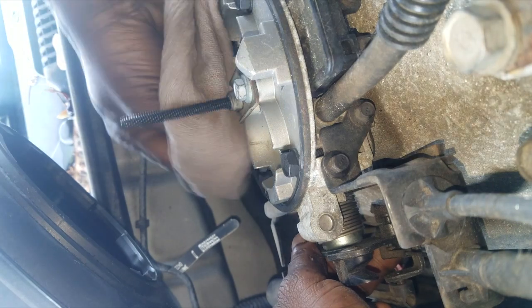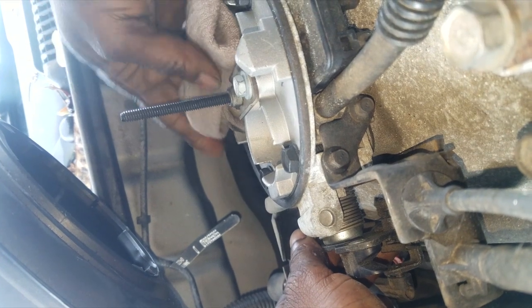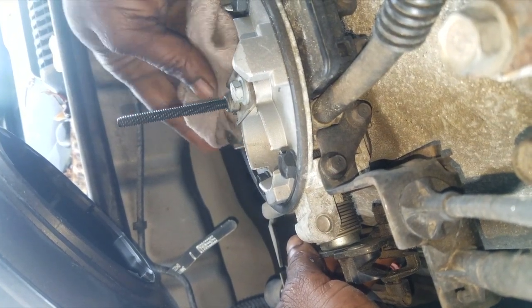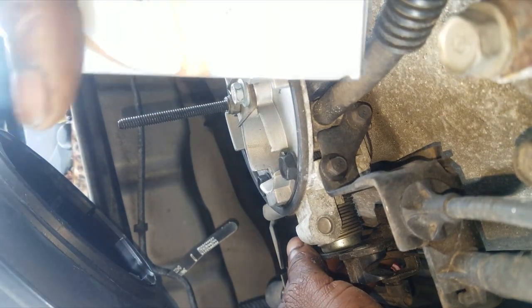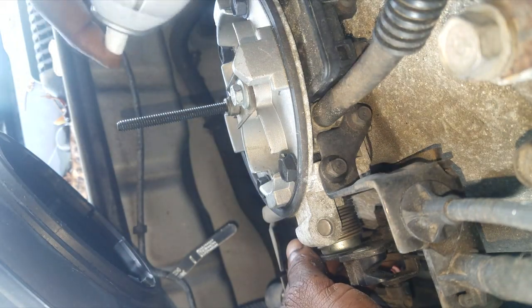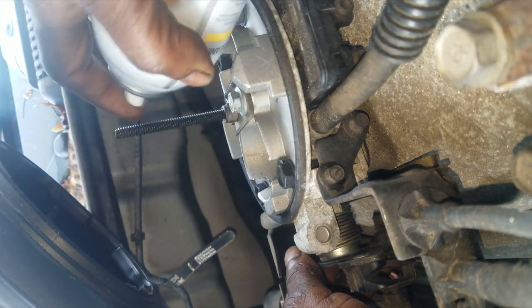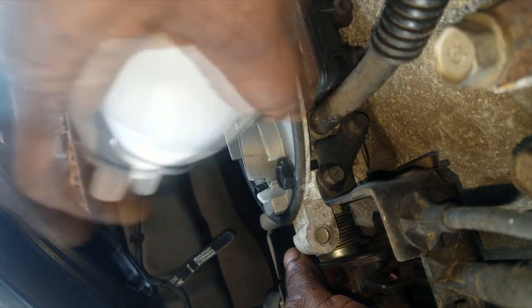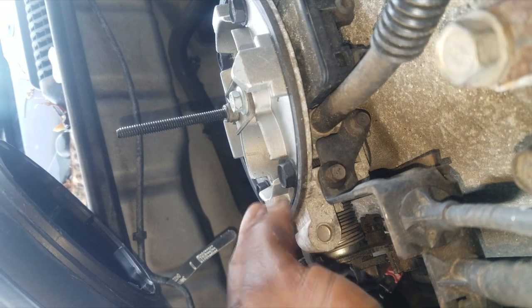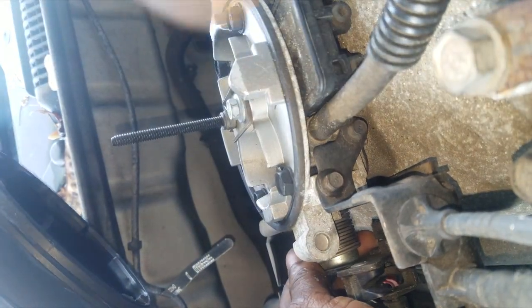What we're trying to do is clean the blades off so the air can get in. Now there's only so much cleaner you can do to the pintle of the AIS motor because it's inside the housing. But what you can do is try to use some of this to try to get on the pintle so you can potentially blow some of the carbon off of it. All right, now I got this as clean as it's going to get for what little I'm doing.